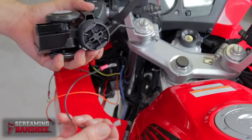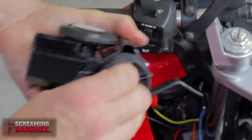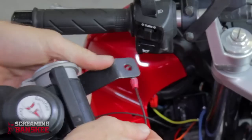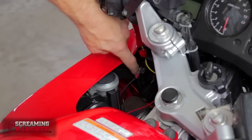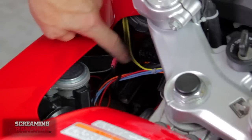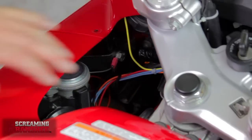I've made up this little ground wire for the horn so we're going to attach that to the negative. The orange wire goes on to the positive. Then the horn can be lowered into place. The horn is now mounted with the two ground wires — one for the horn and one for the control unit. Basically the installation is complete, it just needs the wiring tidied up slightly. A couple of cable ties make the wiring really nice and neat. This will all be covered by the bodywork.